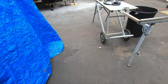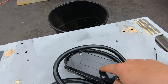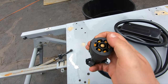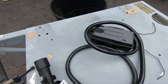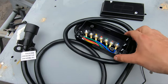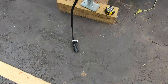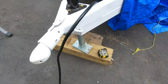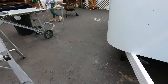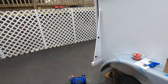I got the four tail lights in. Now I'm going to jump to putting in the trailer plug and junction box — this has all the connections that correspond with the seven-pin trailer plug. Rather than just say it, I figured I'd show you: each one of these studs corresponds with the plug. I got the junction box all mounted up with the trailer plug, and now I'm going to start wiring together the tail lights and the running lights and see if we can make some progress.